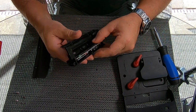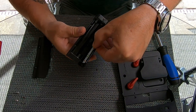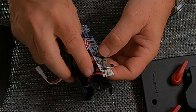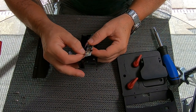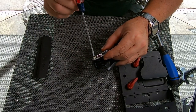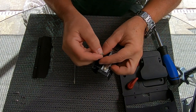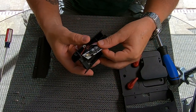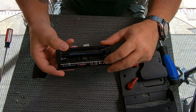The board just slips into these two channels and holds there, and connected is the battery compartment which feeds power to the PCB board via this little plug. After going to replace it, you can see all this corrosion here on the plug. When I removed this plug from the board — look how corroded and burnt out that is. So I needed a new complete setup: a new PCB board and the battery compartment board, and that is what they sent me.